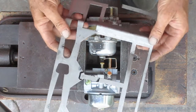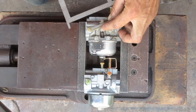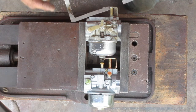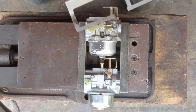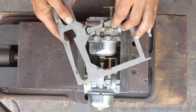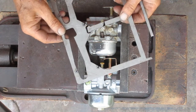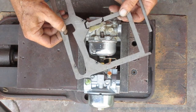So I got a scrap piece of metal here. So there's some different options on here. There's a little piece. It's a little too skinny. This one's about the right size, but I want a little more meat back here so I can make some clearance for that rivet and weld it to the sides. So if I pick some place like in the middle here, I can use this portion that gets wider right here to make a larger area. So I'm going to cut that section out of the middle there. Have to drill a hole in it.